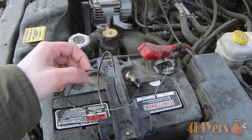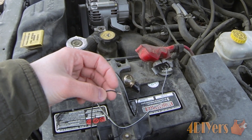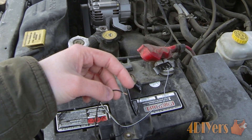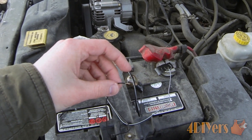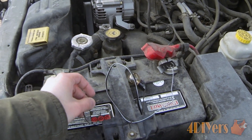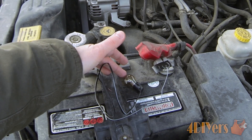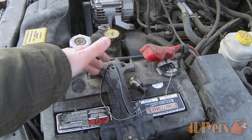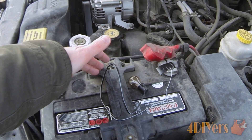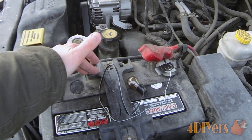If you want to get more technical and you have soldering wire, you can go ahead and solder the wires, since they tend to fray a bit with use. I've twisted them in place, but be careful if you're doing something more specific. If you're in a pinch and need a test light — say you're working on a stereo system or checking whether a wire in your vehicle is getting any voltage — you can use this to do a perfect test.